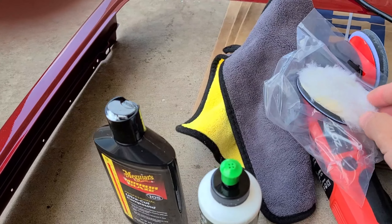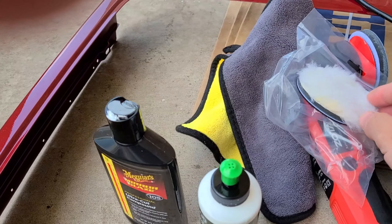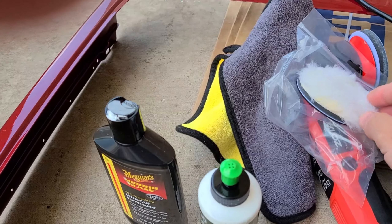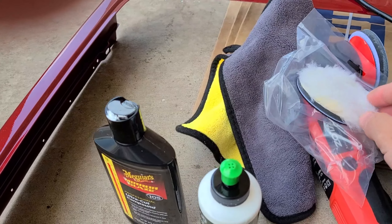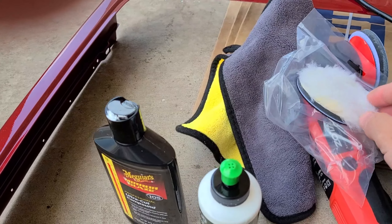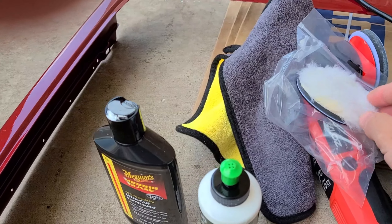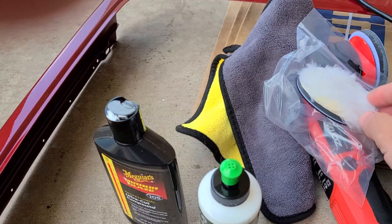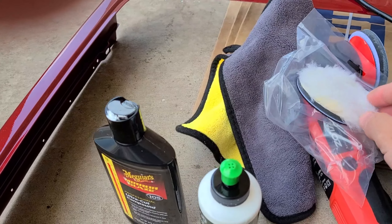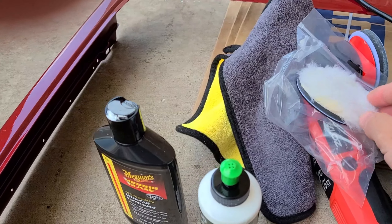What I will say is most of the finish looks even, but I can see in the sunlight a very, very faint area - very light scuffing still from the sandpaper. That doesn't show up unless you're standing really close in direct sunlight. So what we're going to do next is I have a finishing compound, and I'll play with two different pads: this soft foam pad, and a little baby wool pad. Not sure which of these two is going to work best.